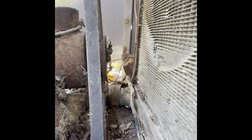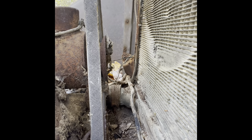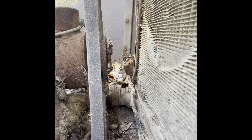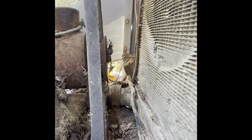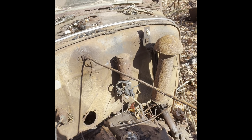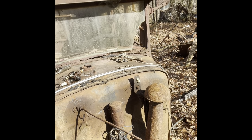What I'm going to do is put this crank in and just show you that it's not free at all to move. The crank is engaged and I'm pulling on it, but it's not budging at all. So we're just going to have to leave it there for now. I'll put the spark plugs back in, put the hood back on, and then depending on weather we may come back in a week — maybe after Christmas — and see if our mixture has done anything to free up the pistons.